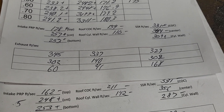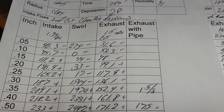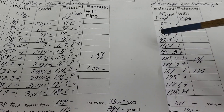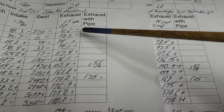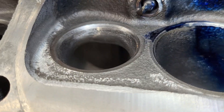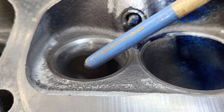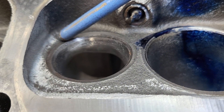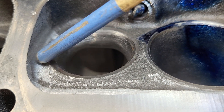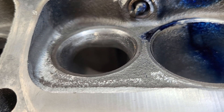Let's take a look at the exhaust port and see if it had as big a difference as the intake port. The second cut is on the left, so these pluses and minuses are in reference to our first cut — not all a winner. I knocked this ridge down a little bit, kind of like a scavenge plateau, and moved this wall a little bit. It's not even all the way to the gasket line because it's only a 1.5 — you don't really need to go that much bigger.